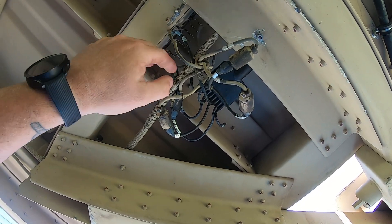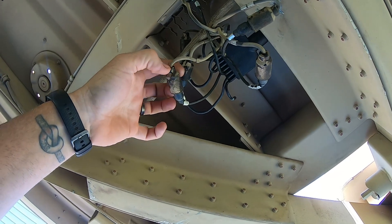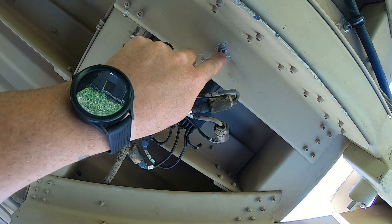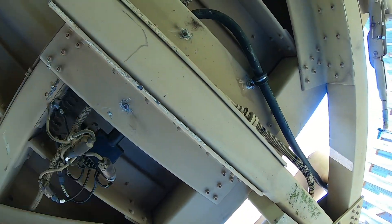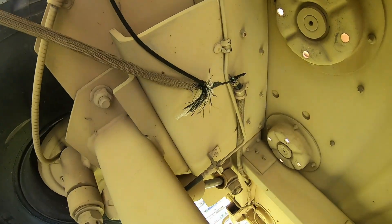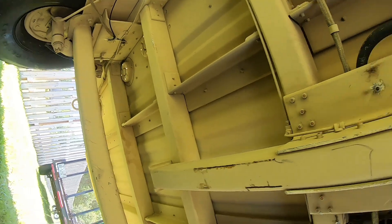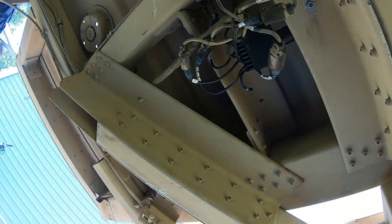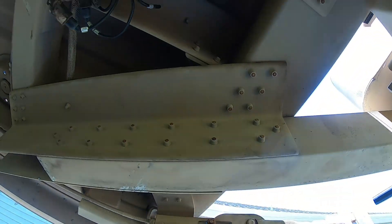Getting up from underneath where the wires connect right here — this is a good spot. I am going to end up cutting off this side of it and connecting the wire straight into the box. I'm actually going to mount my box right here. We're going to take this one rivet nut out, leave the rest, and cut this wire to reuse the holders for the new wire. One thing I do have to address: there was a little bit of damage to that line when we purchased it — they must have stacked it and it grabbed and broke that line. We're going to fix that. We'll drill new holes for the box and it's going to sit something like that, so let's get started.